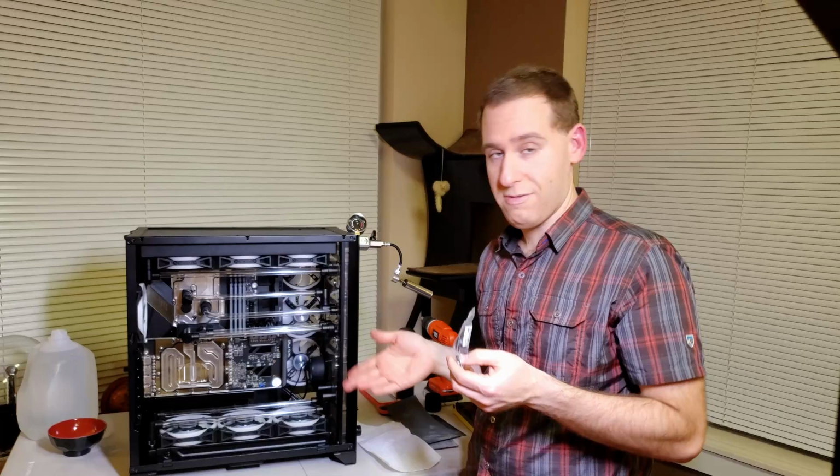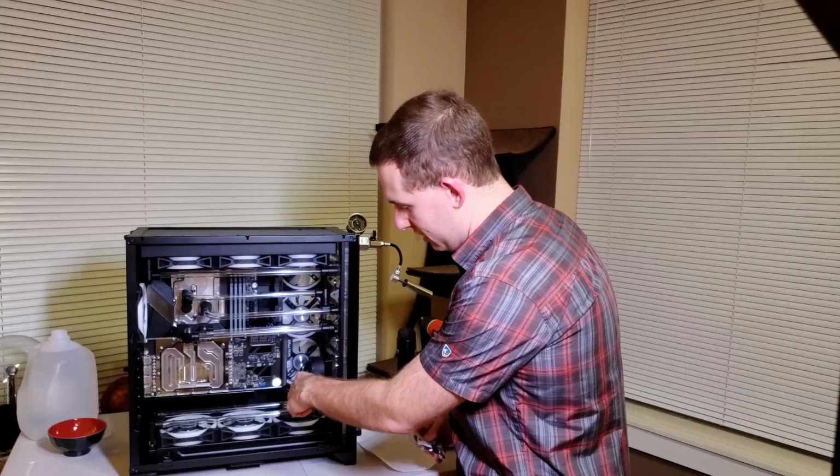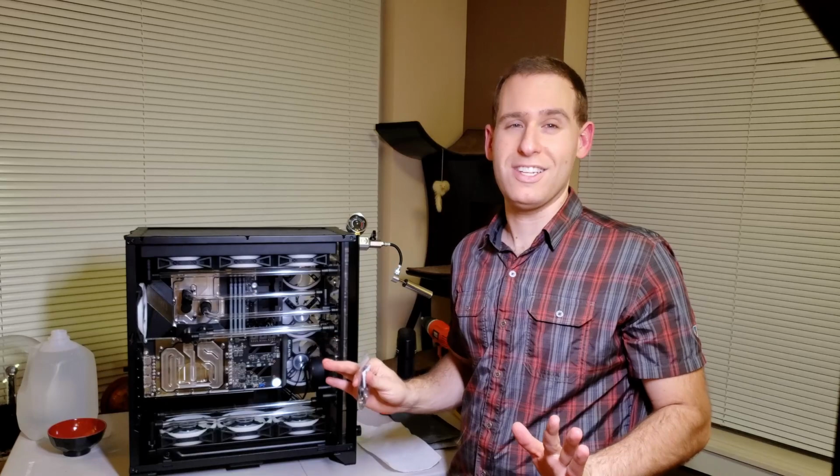I bought, which meant that while I did not have the ability to plug up all the holes but two, I did have the ability to plug up just these two bottom ones in order to test individual components of the bottom radiator. And so what I ended up doing was I detached the tubes and the fittings down here and just plugged the holes in the distribution plate. Just sanity check. I wanted to see, is the rest of the loop okay? Is there something I'm not understanding?